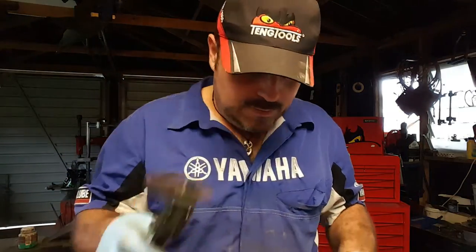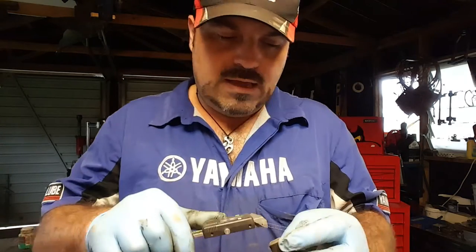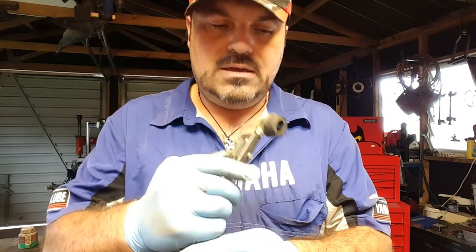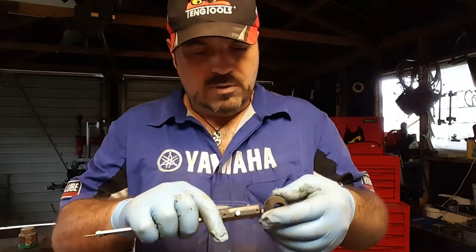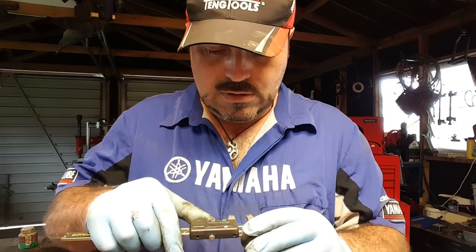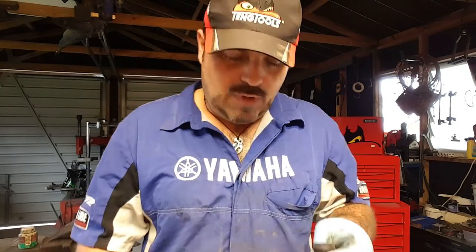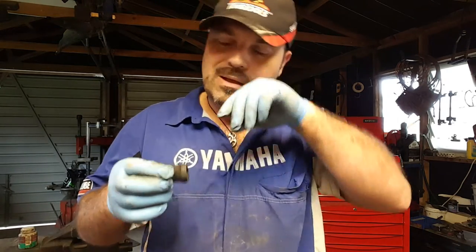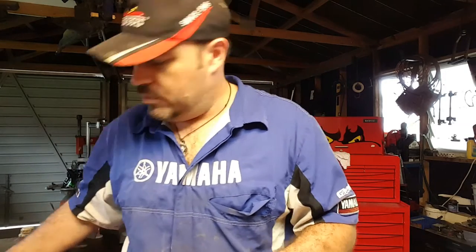So we can get the vernier calipers, and it's only a rough because there's only a few different sizes out there, but we can measure across there. And okay, there you go, very very roughly 15.84 millimeters. What's the new one? Let's have a look. Yeah, 16, just over 16. So they're going to be all right. I mean, it's rubber at the end of the day, and as we bolt up the washer, it'll compress and it'll squash it against the mount. So quite happy that they're the right ones.